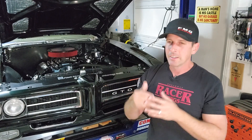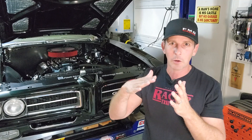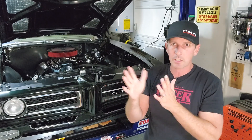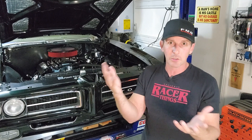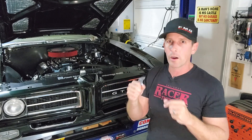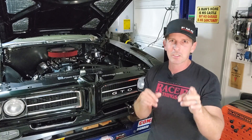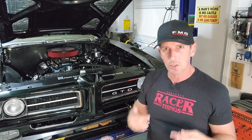50 miles into my journey home — it's a hundred miles up, a hundred miles back — the car started acting weird. Like I had no tach, like it was zero RPM. Granted, I was in traffic, five to ten mile per hour, but the engine was running. The video before the quarantine cruise I put port injection on the car and had to do a whole bunch of wiring, so I thought it was a wiring issue. I pulled over, engine running, tampering at the wires, kind of sounded better. Got back on the road about a mile down the road — the car just quits. I pull over, go to start the car, and it's even worse. Just a tiny click, like a modern car would do when the battery's dead.